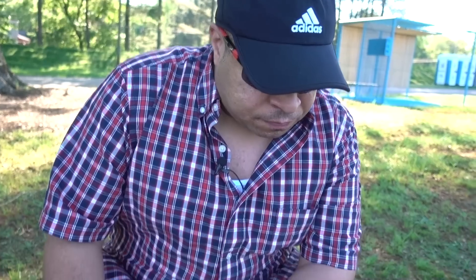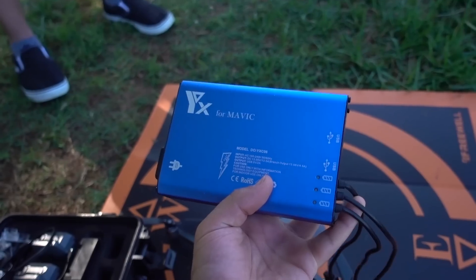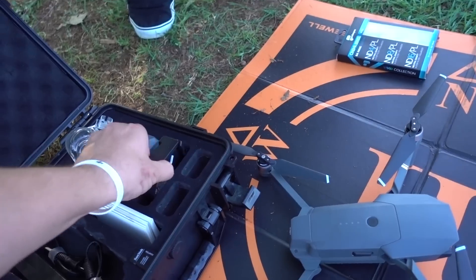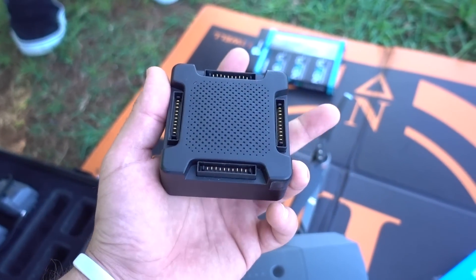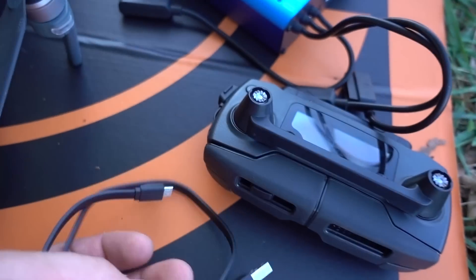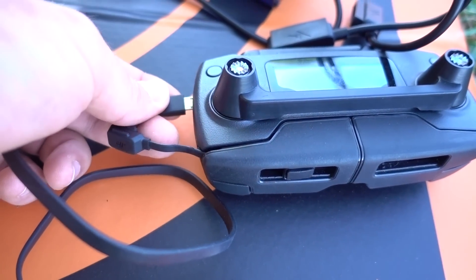How often do you replace the props? Basically, if you start to see wear and tear — maybe landing and hitting grass — you'll eventually see little nicks in your props. If they look okay and sound okay, you're probably fine. Maybe every couple of months if you're really using the drone a lot, just inspect those props. This is also a fast charger for the Mavic — it charges batteries a little faster, but more importantly it charges them simultaneously. You can charge three batteries at one time, which is great. The normal hub from the Fly More Combo can only charge one at a time even though it has slots for four. To charge the remote, you use a USB to micro USB connection, and you can plug in the micro USB to lightning cable we installed earlier — that's how you charge the remote.